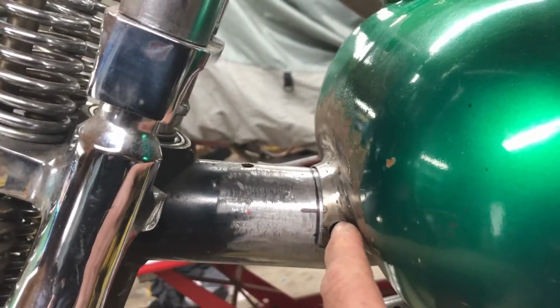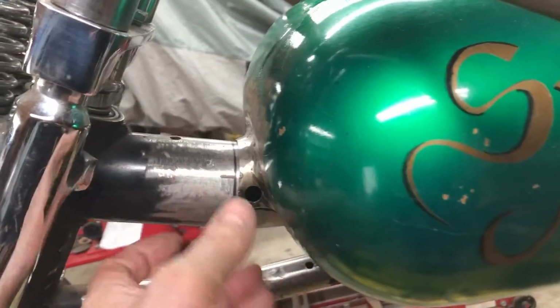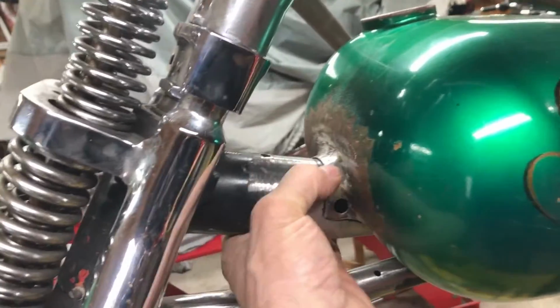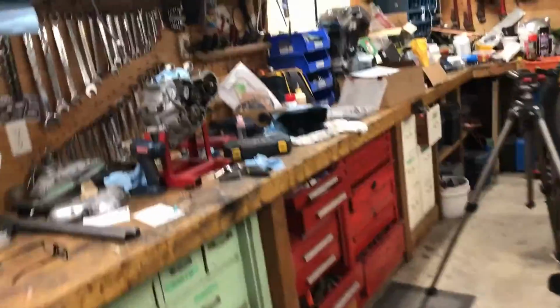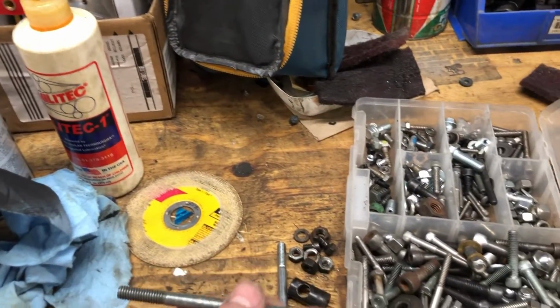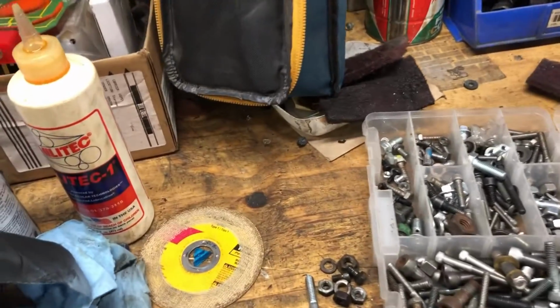Drilled straight across. But what I'd like to do though is get a spacer, a tube through the frame, weld it into the frame, so you just slide the bolt through the tube. It'll make it a lot stronger. So now I gotta find a tube that'll hold a 3/8 bolt. That's what I wanna do. Or 5/16, these are 5/16, that's plenty strong enough. I don't really wanna drill out one 3 or 4 inches long. I could make my own, but I'm gonna see if Peter's got any kind of piping around.